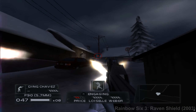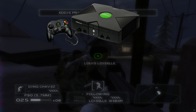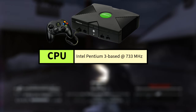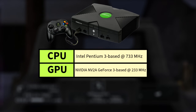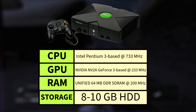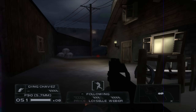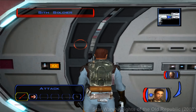I love to kick off the GPU breakdown series with a basic overview of the entirety of the system specs of the Xbox before we dive into the GPU and how it worked. For its CPU, the original Xbox had a custom Intel Pentium 3 based chip at 733 megahertz. Its GPU is the aforementioned NVIDIA NV2A, a custom GPU clocked at 233 megahertz. It had 64 megabytes of DDR RAM at 200 megahertz and also included 8 to 10 gigabytes of internal storage. This hardware made the Xbox more akin to the gaming PCs at the time of its release than any of the other Gen 6 consoles, and was also easier to develop for based off the hardware alone.